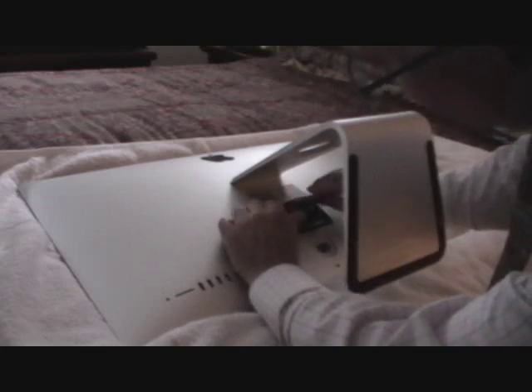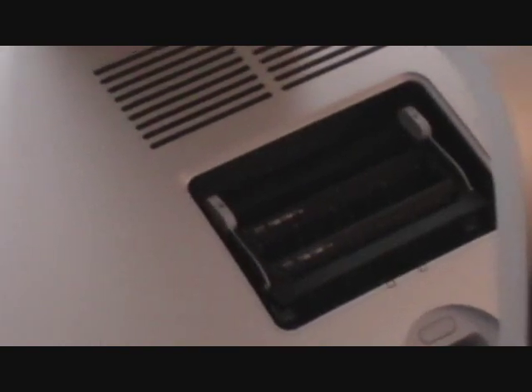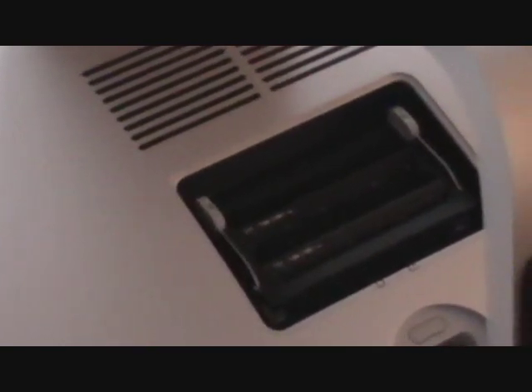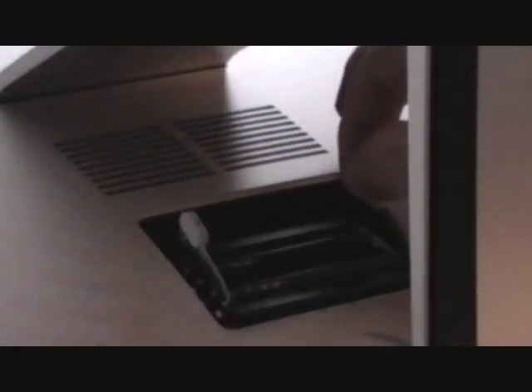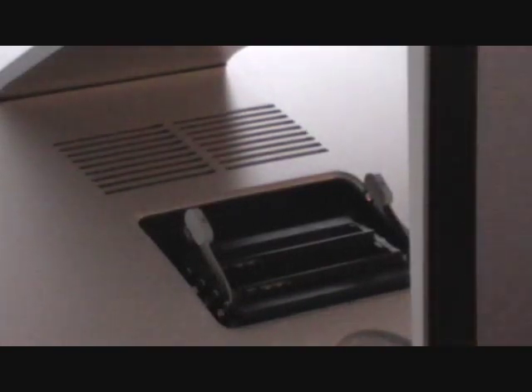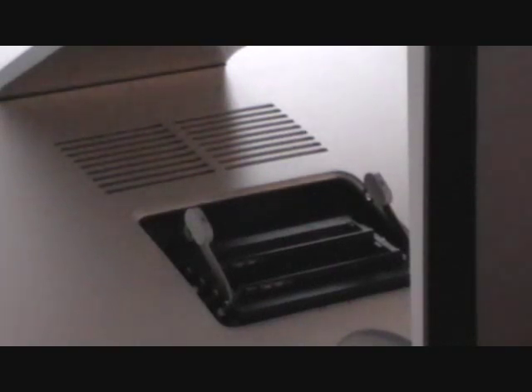Pull out the back here, and let me zoom in a little bit. You see those two white levers — well, you pull those out and it kind of unfastens the memory so that you can install some more. Right now there's eight gigs of RAM in there. If I take these two levers out, it pulls this whole assembly out, and there are spots to put two RAM sticks.